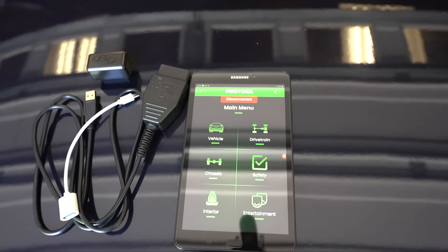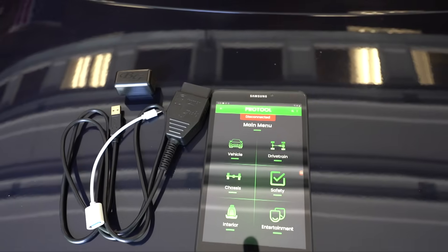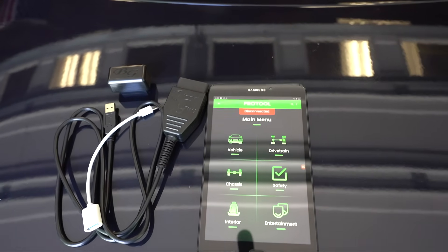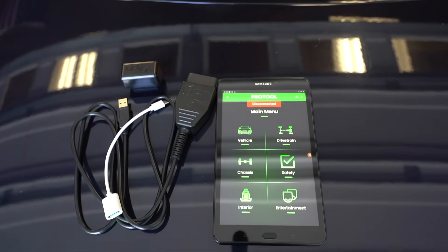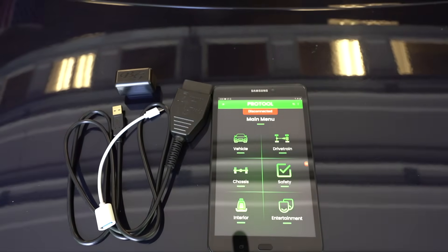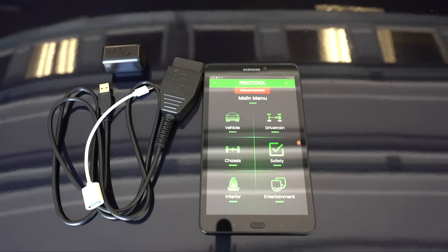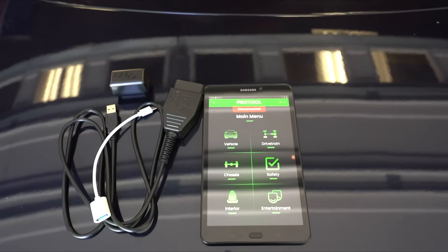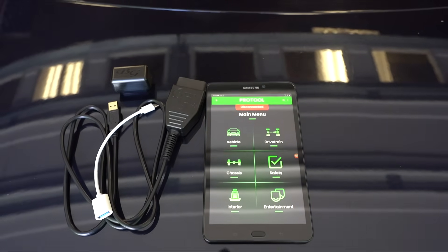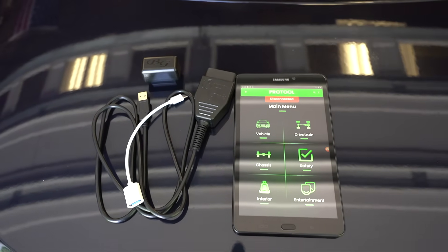Unlike INPA, all the codes are in English and everything is very easy to understand and replicate yourself, even if you're following NCS Expert coding instructions. For example, we were trying to get rid of Matt's tire pressure monitor sensors — we didn't have NCS Expert at the time, but we used Pro Tool to fully disable everything in the modules and pull out a specific code from the vehicle order, then rewrite the vehicle order to the car very easily. One thing to note: it currently doesn't support the E46, E39, and E38, but support should be added in the future and they're looking at expanding to the F-series as well.